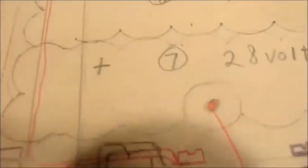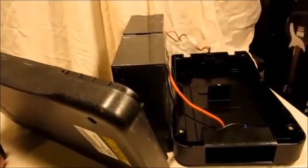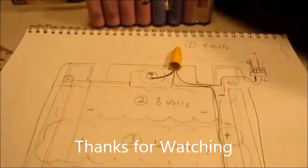There's a section here that you have to grind out, and a section back here that you have to grind out to make room for the red wire going on top. It is so tight that you actually have to grind out the wings of that to make room. Everything's a real tight fit, as you'll see, but the end result works pretty darn good. If you're converting an old-style EZIP lead-acid battery pack to lithium-ion, these are the steps I discovered I had to do in order to make it all fit in there, and it worked out really well.